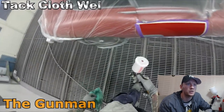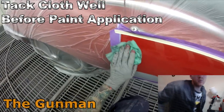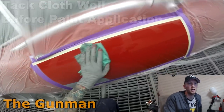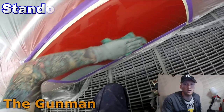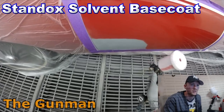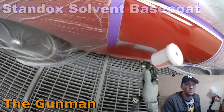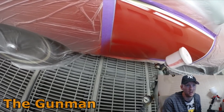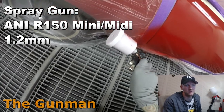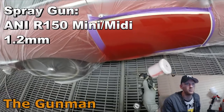Got the base coat color, blended and strained it into the gun. I would recommend with these kinds of spot repairs to use base coat/clear coat because your clear coat is going to fade out a lot easier than 2K direct gloss or single stage. Reds don't usually cover that well, but this is an HP red — high pigment — and even then you can still see that if that was black, one coat you'd have just about full coverage. So I'm going to have to put a few coats on and make sure it's covered before I clear it.